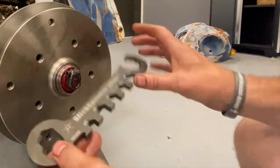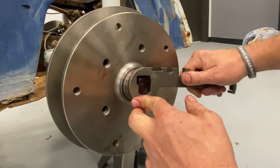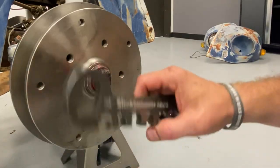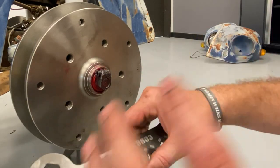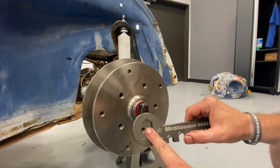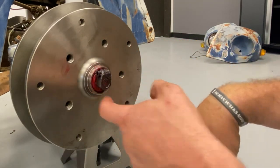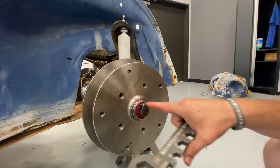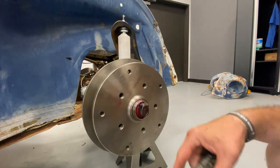I just had a second thought regarding the Slick Spanner — perhaps because my bolt was too loose, but even with the bolt tight, it doesn't fit over these aftermarket axle nuts. And that's no knock on Air-Cooled or the Slick Spanner. I've known Pete for many years; he designs and builds and demands quality. Whereas this thing fits the camber adjuster like a glove, this is cut out for an original axle nut. If you have one of these tools and want it to fit aftermarket nuts, just grind the aftermarket nuts down to original tolerances.